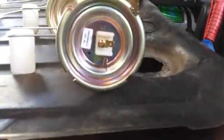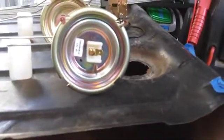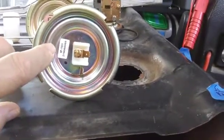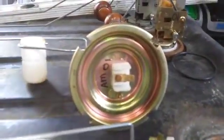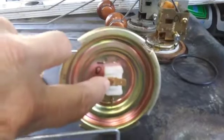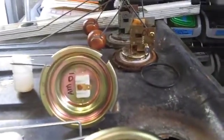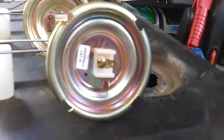The first thing you notice is that the Mexican sender actually does have a label on it that tells you their part number, which is 1F161. The Impey sender will have no stamps or anything on it. This little tab right here that holds the sender tab on — on the Impey it is dull and flat on the top, whereas the Mexican sender is rounded and kind of shiny.